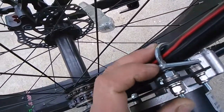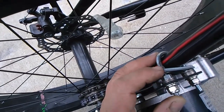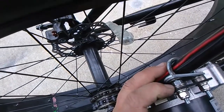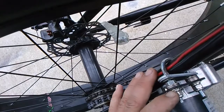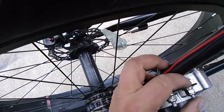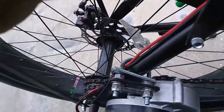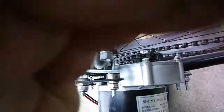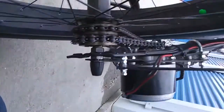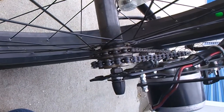So I ended up getting U-clamps from Lowe's. These U-clamps come with straight bars, and I actually used two straight bars — so it takes two clamps to make one. The configuration is: two straight bars, a washer, a nut, three washers, a washer, a lock washer, and then a lock nut. On the back I have five washers and the same lock nut configuration. It's pitched slightly, but you have to do that to get your chain straight — your chain must be straight or it'll jump off sprockets.